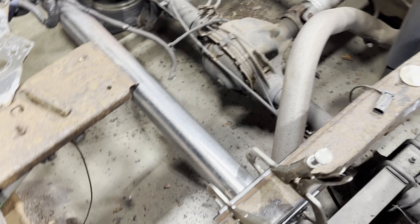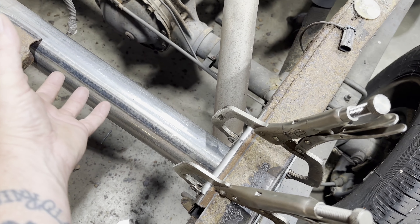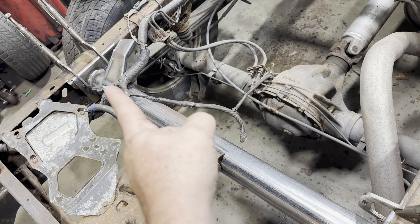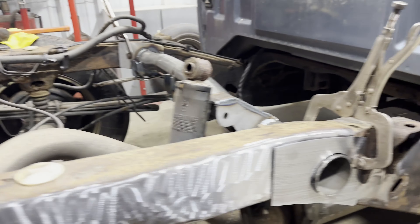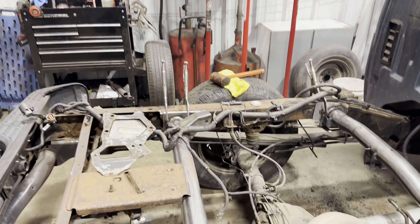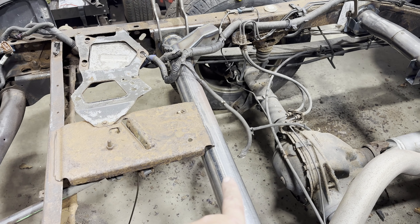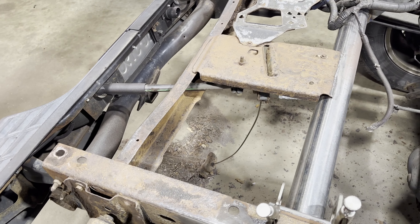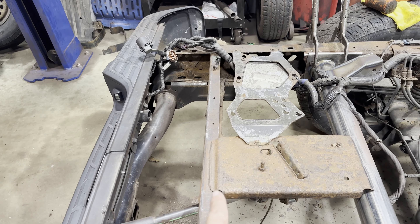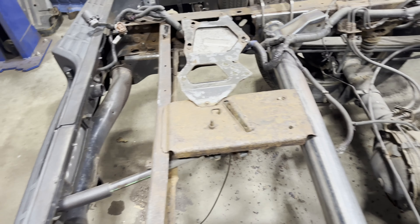The safety cap makes this thing super easy too. This side right here is not welded to the tube, so you slide this plate over the tube, slide the tube into the frame, dip it down, slide it into that side, and then clamp everything in place. They give you these nice outside strengthening plates for both front and rear, and then we'll be able to reconnect everything and re-weld our spare tire carrier to make sure that's all safe and sound again. Oddly enough, the crossmember back here is still pretty good — they do make this one as well, but luckily we didn't have to replace it because it's still solid, which is surprising. They're usually gone.